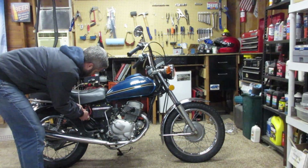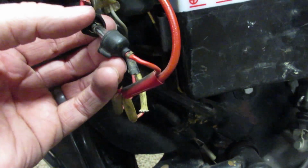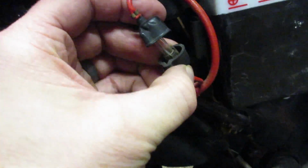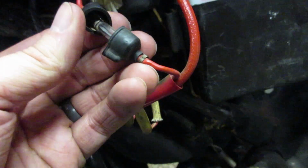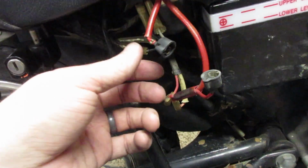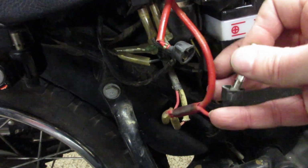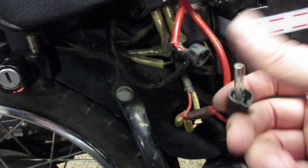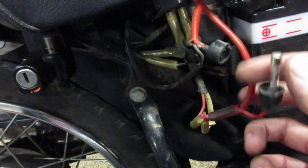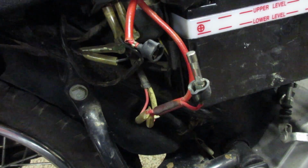Oh! What's happened here is, I noticed this before, but someone's just got a fuse hanging in this little fuse container. And what's happening is it's coming loose. I think the tube fuse that was in here was just faulty. So I'm going to go ahead and replace it with another one. And surprisingly, this looks like what they had from the factory. Might have been a different non-glass fuse, but I'm going to go ahead and replace this and try it again.